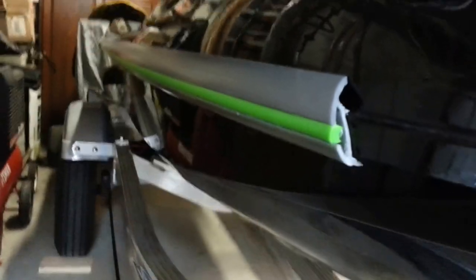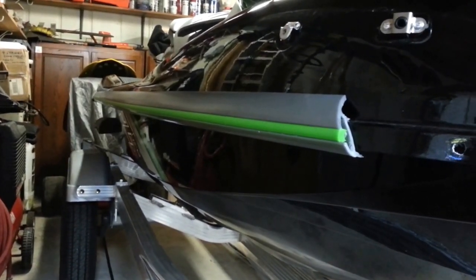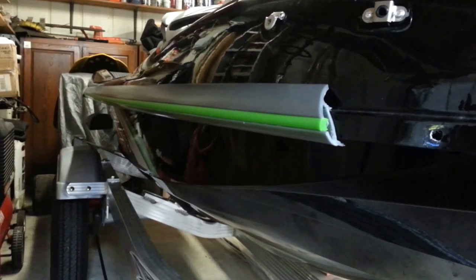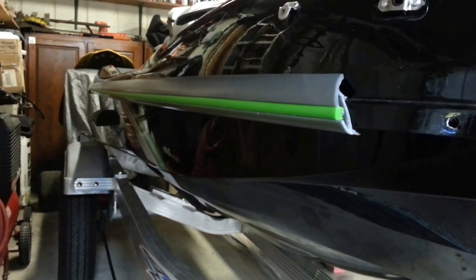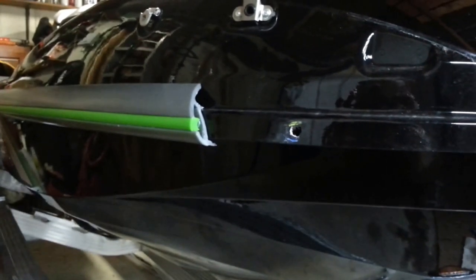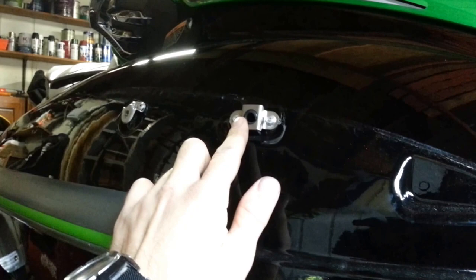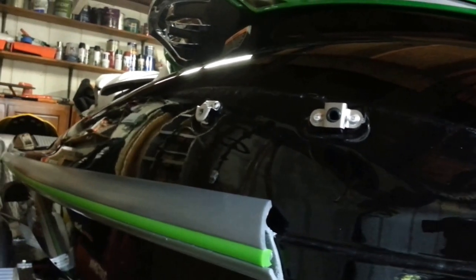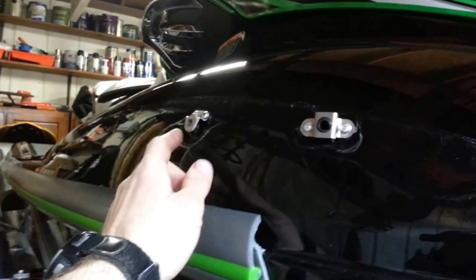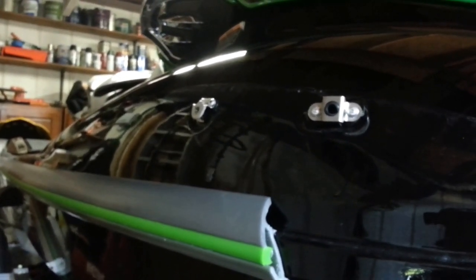That's been inserted the whole way. It looks good and I think that'll hold up for quite a while. At least now I'll know in the future if I ever bang this up or get it grimy, it'll be pretty easy to replace. At this point, pretty much reinstall everything in reverse order. You'll have to give the outer plastic piece a little love tap to get that grommet reattached. The last thing — and I forgot to mention this earlier — is you'll have to add a little bit of Loctite, but only for the Allen bolt. The Allen bolt is the only one you'll need Loctite for; the others won't need any. That'll get this back to factory standards for the most part.